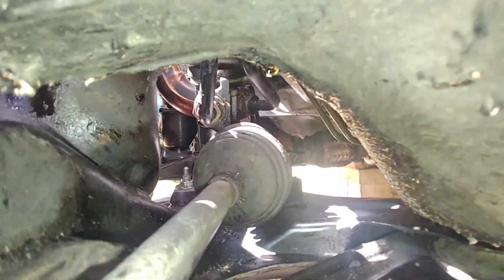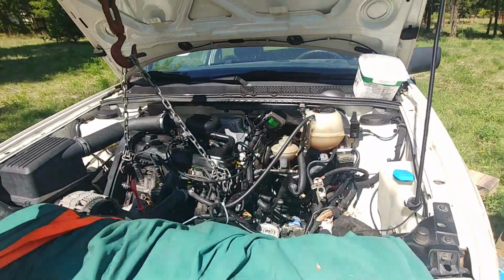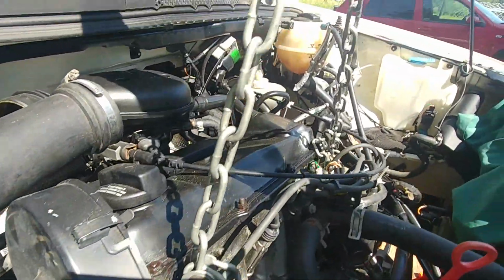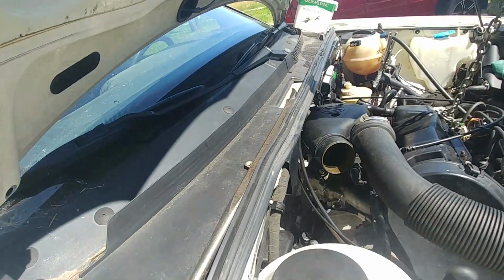See? Now I put in the bolts holding the subframe to the vehicle chassis. All of them I started. I align the holes. I don't go all the way. I just go half the thread of the bolts. Keep them loose. It gives me some mobility to align the holes, because we still need to install the engine mounts and those supports for the transmission. As you can see, I still have a crack gap. I don't torque anything, don't tighten. Just give yourself that flexibility to align the rest of the fasteners.